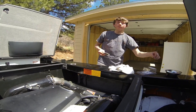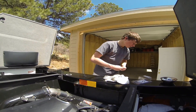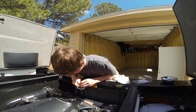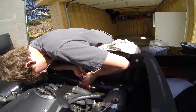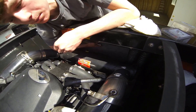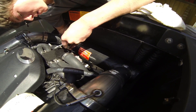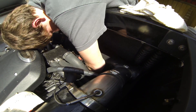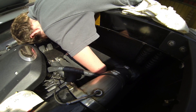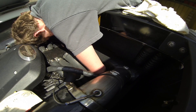Get it on there with the screw — screw it back on and test it out. I've got my 5/16 screwdriver and you just want to screw it back on. I have a towel below the impeller just in case I drop a screw — it's just going to land right on the towel. That's just a nice little tip. You've got to go right around the exhaust, which is kind of a painful spot to be in.